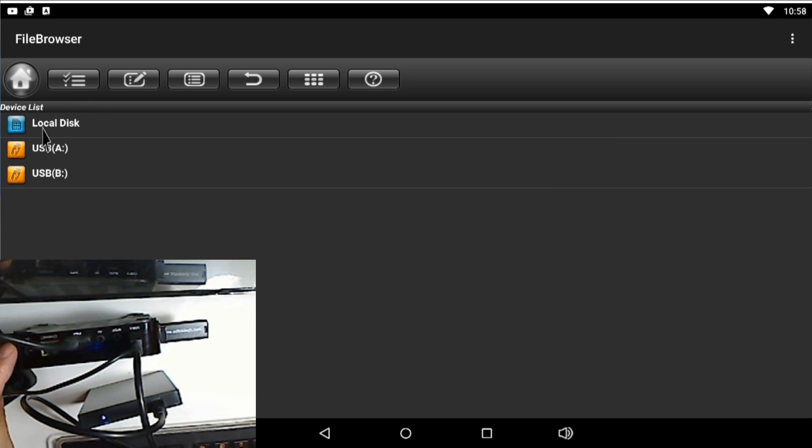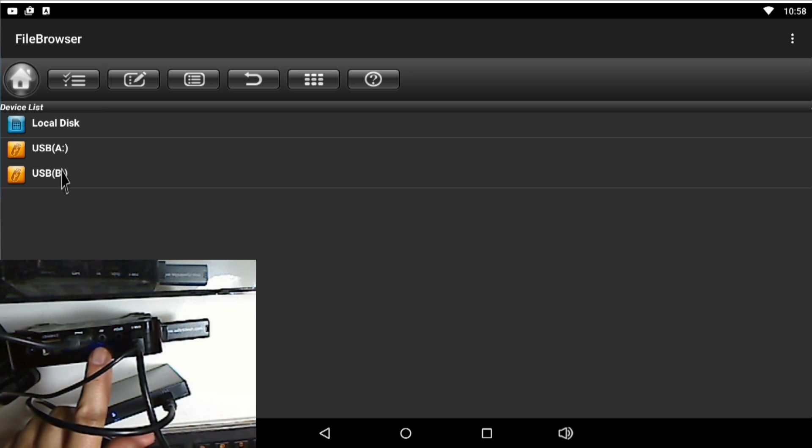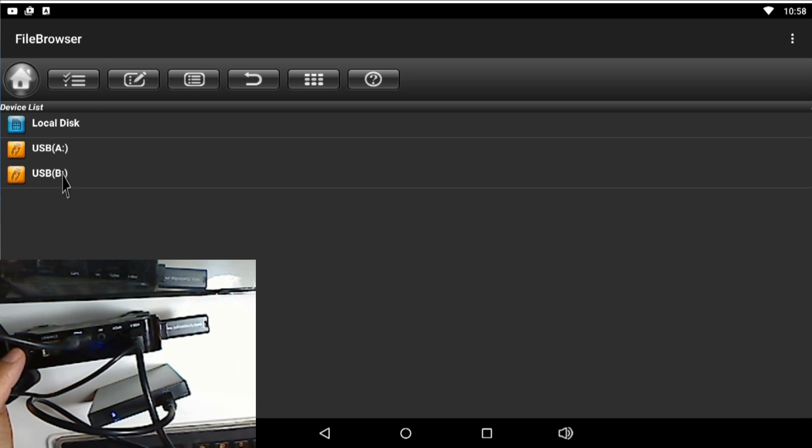We can see both drives. What I did is power from the external USB hub — I think it's two amps — and the hub has its own power supply that I use for my Windows devices. So I'm powering the hard drive and the box at the same time from the hub. Now if people try to shut down the box there's no way to shut it off because it's getting power from the hub — you'll have to take that power off.